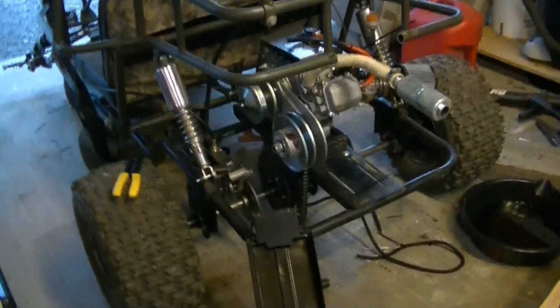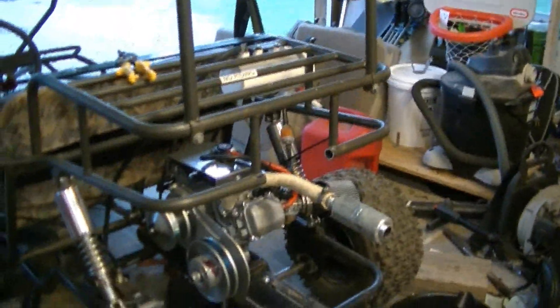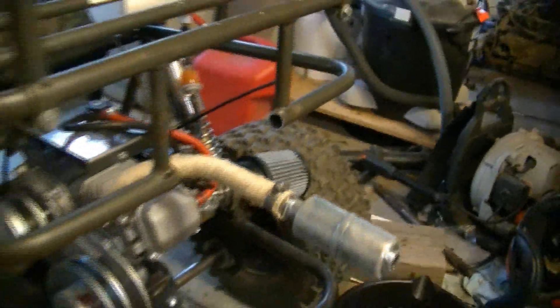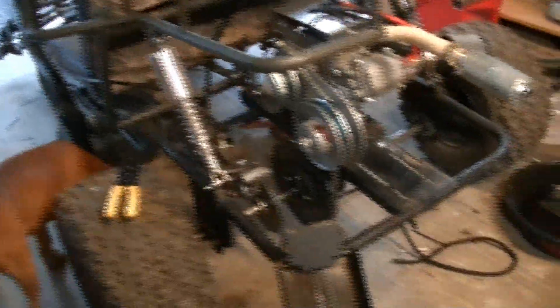Here's the motor. I had to cut part of the frame out because it was only about an inch to two inches from the muffler — if the suspension flexed going over a rough spot, it could hit the header pipe. Better safe than sorry. I'm going to take it to my brother's to get it welded and cap those bars shut so water doesn't get in and rust them. The motor is mounted, fuel lines are ran to the tank, but I still need a cap for the fuel tank.